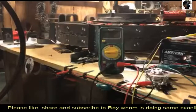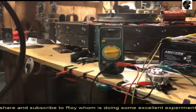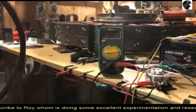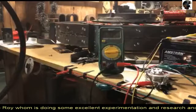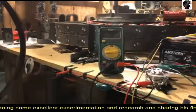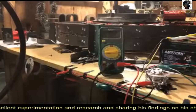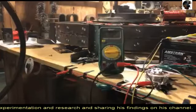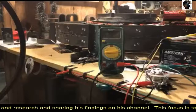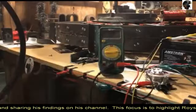So it looks like it has to be half of it above the pressure of the battery. So if the battery's at 13 volts, there's a certain pressure that 13 volts provides into that battery. And in order to get it to charge any more, you'd have to up the voltage or up the pressure of your charging device for it to overcome the 13 volts of pressure. And you can see, look, we're back up to 13.5 on that.